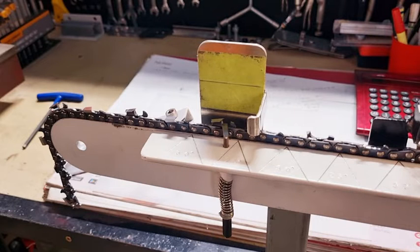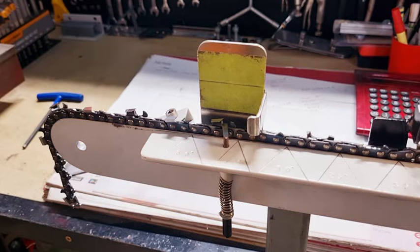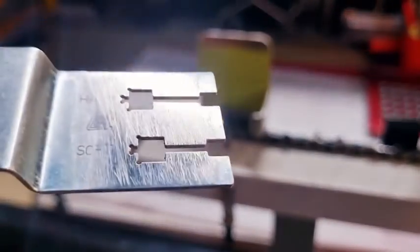And you're pretty much limited if you can't get a steel one. The steel one is my favourite because it's been hardened to 62 Rockwell. That means that if you run the file over it, the file won't affect it because the file is softer than the actual depth gauge itself, and all that will do is scratch it. The one that I'm talking about, for those that may not be familiar, is this progressive depth gauge from Stihl, hard and soft setting. And as you can see, it just has a million scratches over it, and that's all you're ever going to do to it.